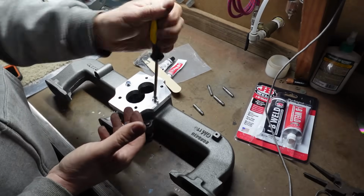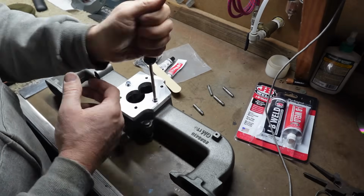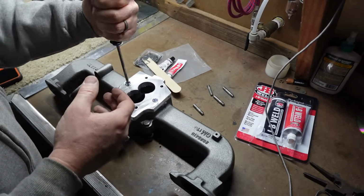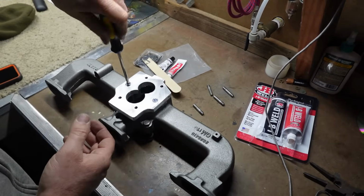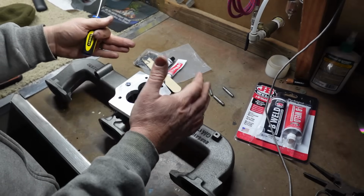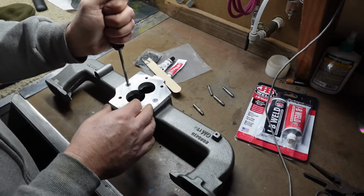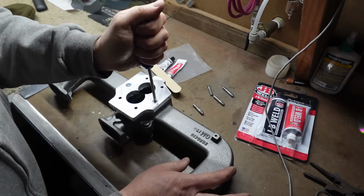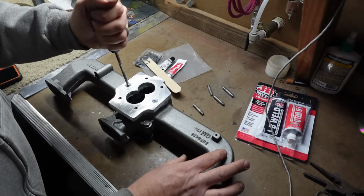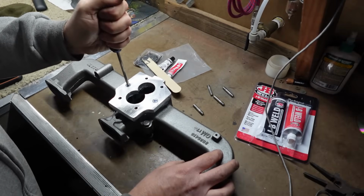Now, my thoughts on the screws aren't necessarily that they're the primary holding thing that is going to keep this thing sealed up and in place. Yeah, it does play a role in that, but primarily my thoughts were that it would index the plate to the manifold, obviously, and make sure it's centered. But also, for this purpose right now, giving us a good squish down for the gasket, quote unquote, that we're making out of JB Weld. It obviously will prevent that thing from separating, keep it in place.